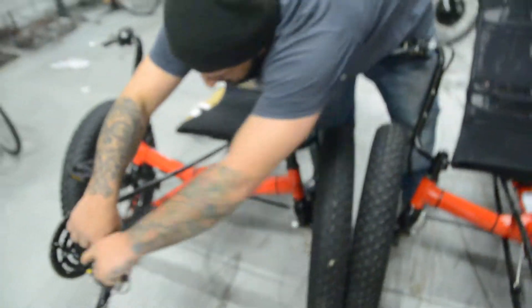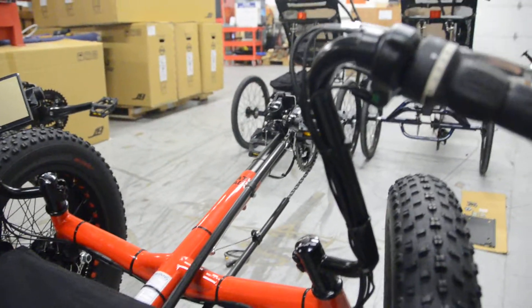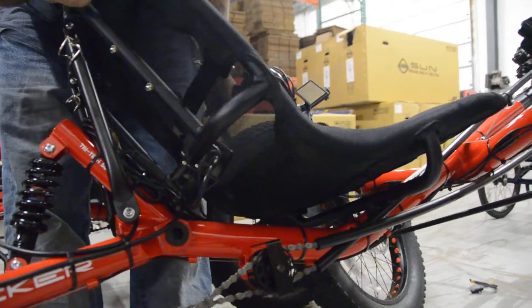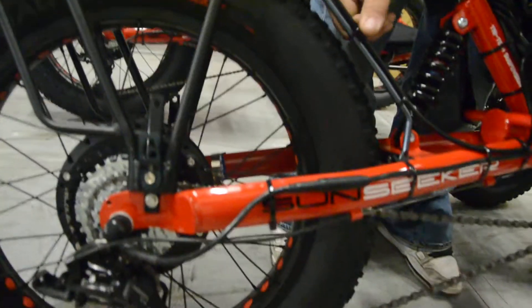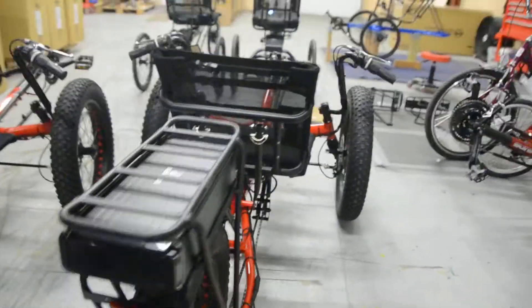So that's how we set up these Fat Tads. Let's take a close look at the cabling and how we do it. You can see we run it down along the handlebars keeping it out of the tires, along the outrigger, and under the seat. When we get to the back, we bundle up the extra cable and screw the controller directly to the frame for the seat, and tilt it so that it doesn't interfere with your back as you sit on the seat. Then out of the controller, we run the battery cable up the leg of the rack and the motor cable down the right hand chainstay. When you're all done, you take a step back and it looks like a bike that was meant to be a fully complete electric bike.